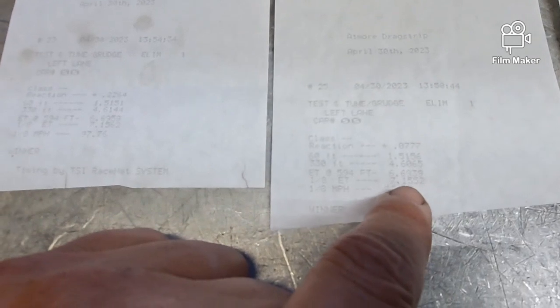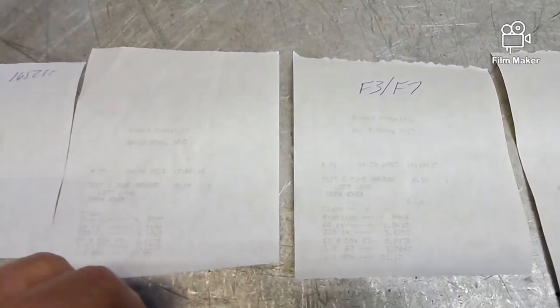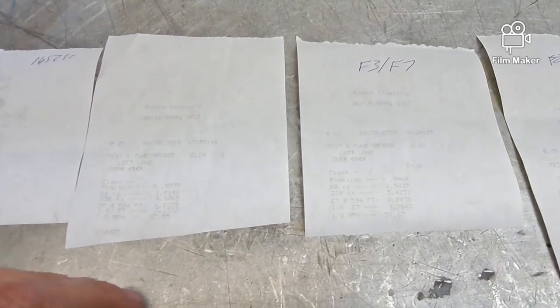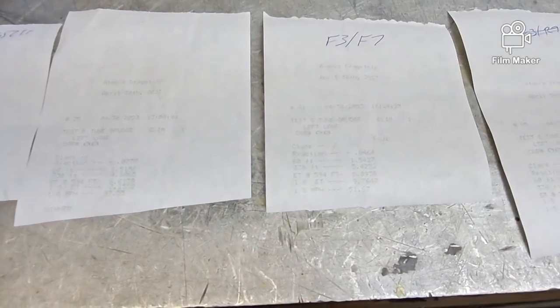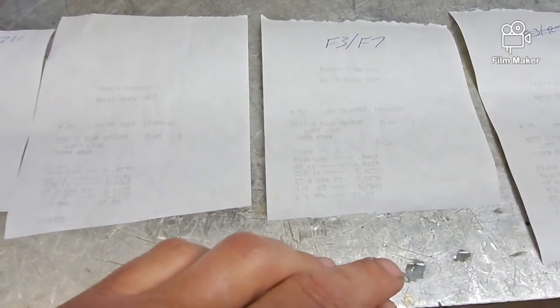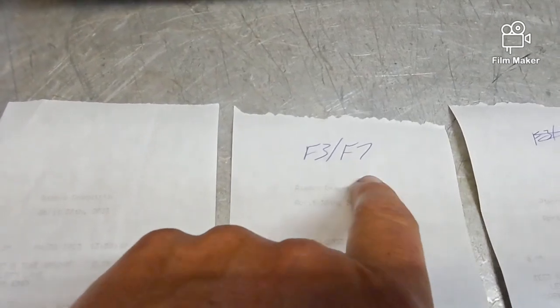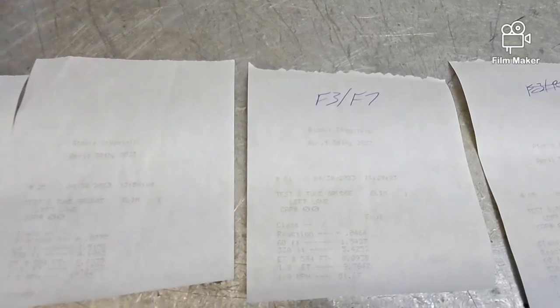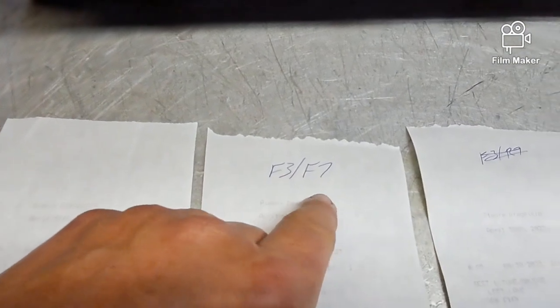Went around for a hot lap, came back, did a 1.51 60 foot just like the first time. 7:15 like the first time at 97.55. Dropped off just a little bit. Then I went back because it was pulling the wheels hard. Those stiff walls, I do like them because the car is a lot more stable going down the track. Typically it moves around a lot, especially at top end. This thing was just straight as an arrow. So I changed the front struts to 3, and the back shocks to 7. Last time I was there, in the first 2 passes I had them at 1 and 5.